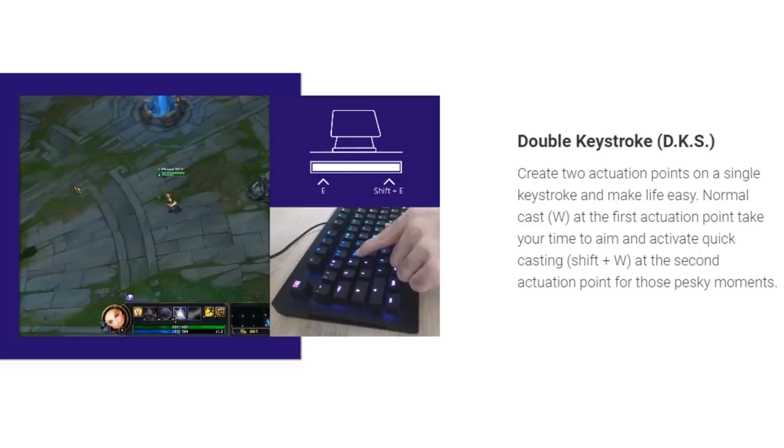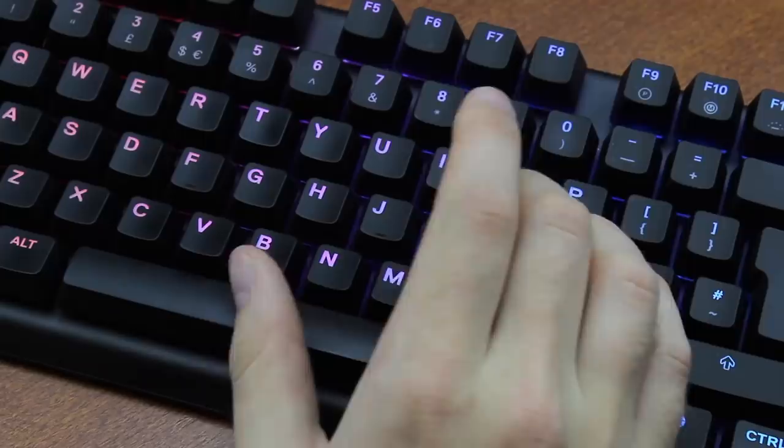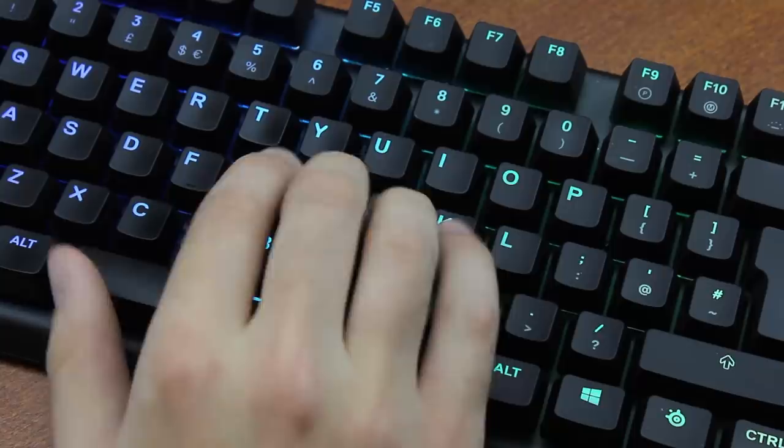At the moment, the SteelSeries doesn't support this, but I've been told it's something they're looking into. As this is a firmware software thing, they can retroactively upgrade all existing models with this feature via an update, which is pretty cool. So that's one advantage of using the Hall effect in a keyboard, analog sensing. But there's another, it's contactless. And what this means is that the switches can be smoother and therefore nicer to use.